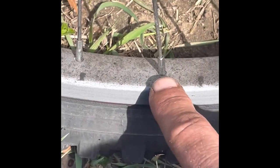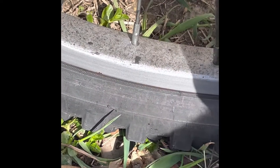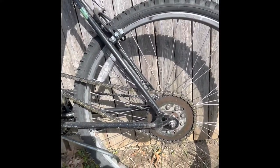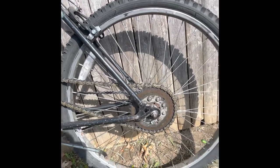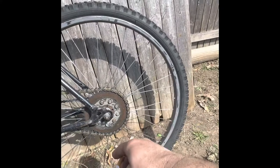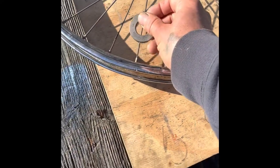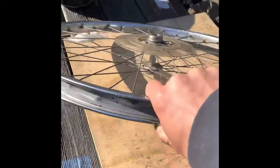You can see right here there's a big old holiday at the bottom where the far side of the rim on my setup is not really getting the brake caliper action — so that's where I need to pay attention. Going every other spoke, and like I said before, usually it's clockwise and that's gonna bring that back into line. You can get rid of the primer with a little bit of lacquer thinner or nail polish remover when you're done, or it'll just wear right off if you're not that concerned about it.